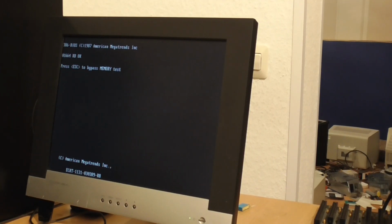We'll see if it does the memory test okay. I think these are 1 meg modules, so there should be 4 megs there, and I have another 4 megs, hopefully, if it's arrived, and that should bring us up to 8 in this machine. I can't use 7, of course, it needs sets of 4 modules in the board. You can see it's certainly very slow, but I'm assuming that's because turbo is off, as it was with the other board that we tried in the last video. And so far no problems with the memory count, so that's looking pretty good.